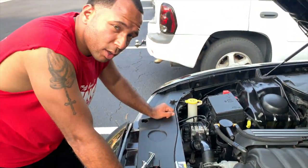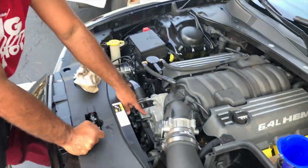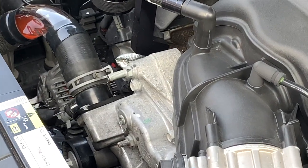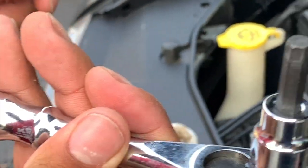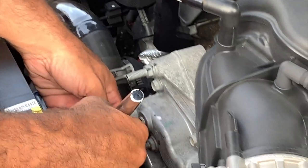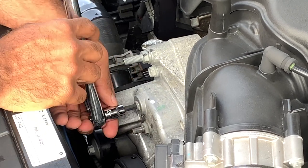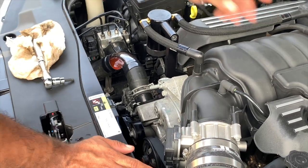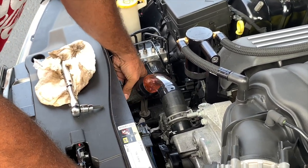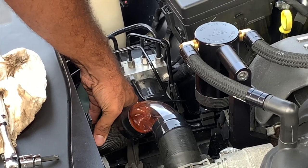The biggest thing now is to make sure you fill your coolant reservoir back up, and then bleed the cooling system. To bleed the system — there's a bleeder screw right here. It is a quarter-inch hex bolt. You want to make sure it doesn't have any play because you don't want to strip that screw out. Once you fill the coolant reservoir up, all the fluid I put in there ended up topping the reservoir out, so don't let that scare y'all. You can burp the system by squeezing the hoses a little bit to get some air out.